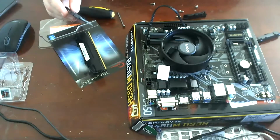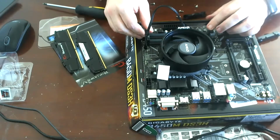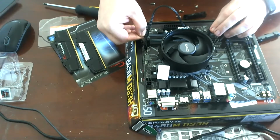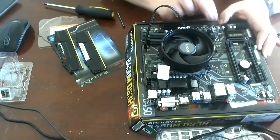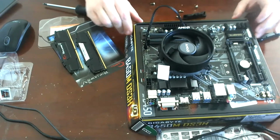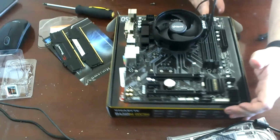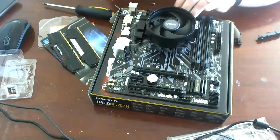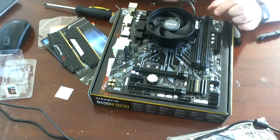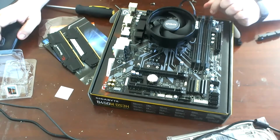Now, as I pointed out before, when you're using dual channel memory and you have two sticks, you want to put each stick into an opposite channel. On this motherboard, the slots for the channels are the same color. So we're going to use, because it's a little bit more convenient to get to, slots 1 and 3. Let's make sure that we believe what we just spewed out of our mouths.